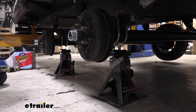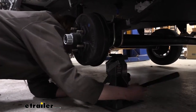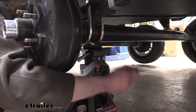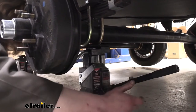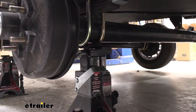I'm going to take my handle and jack up the jack until it just touches the bottom of the axle. When you jack it up, you want to try to stay underneath the leaf spring stack — we don't want to jack up at the middle of the axle, which could potentially bend it. We just need to kind of touch it, maybe put a hair of pressure on it, and we're going to do the same thing with the other axle.